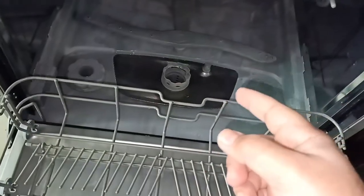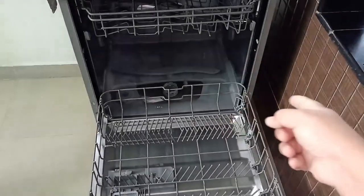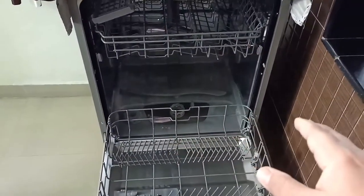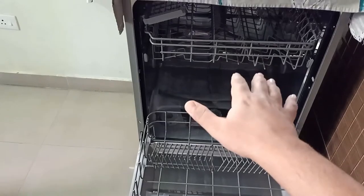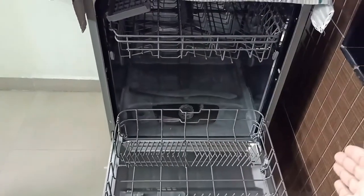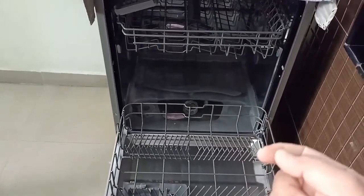The next is the drain line — the outside part. We don't have to clean or monitor it frequently. Only if you find someday that water is getting stagnant inside the dishwasher and not flowing outside — that means the drain line is clogged. Only in those cases do you have to open the drain line, clean it, and fix it again.